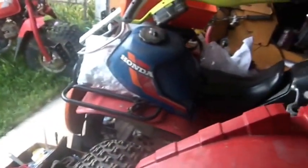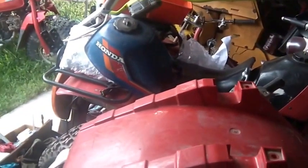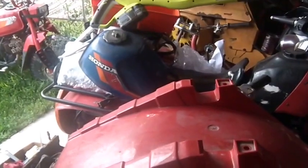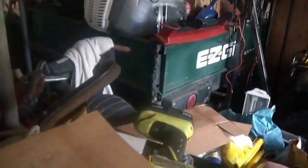Right, there's 6 of these. M6 by 1 by 25. You can see they're a bit longer. So dumb little things like this, when you can get your hot little hands on them, it just pays to. Particularly the nuts, bolts, hardware like that. There's nothing worse than finding a bike that somebody used half American hardware on and half the right hardware on. You go to take stuff apart and put it together with the right hardware, half the time it strips out. It's just really a mess. And a good mechanic uses SAE bolts to replace SAE bolts and a metric bolt to replace a metric bolt. They don't thread the wrong ones in, unless once again they want a mess.